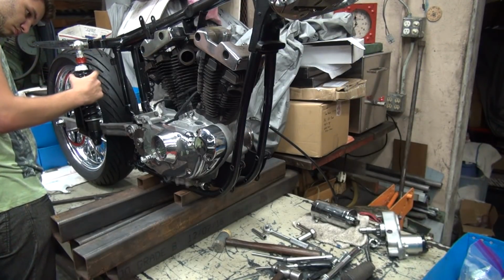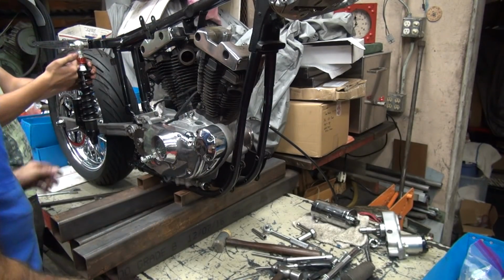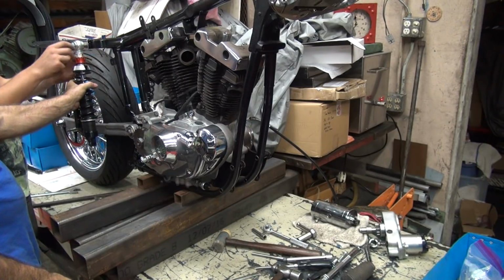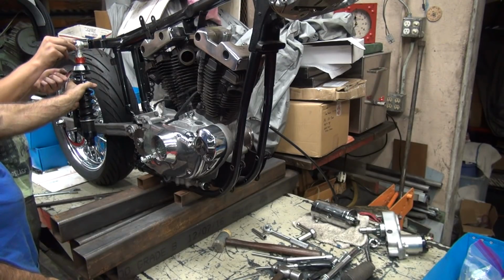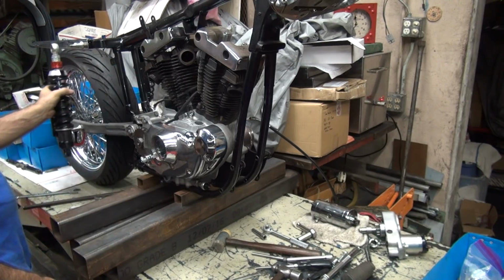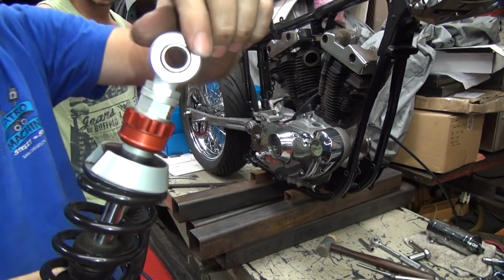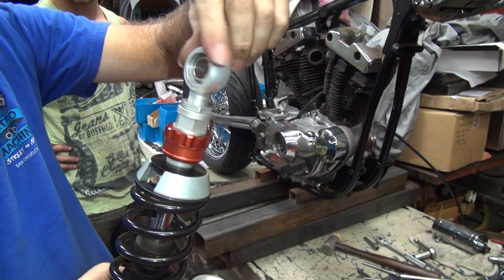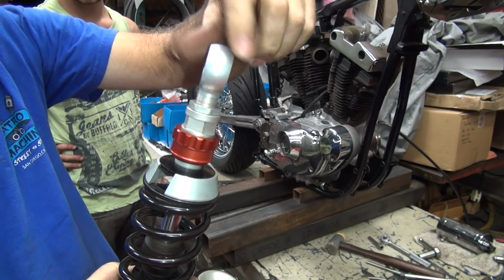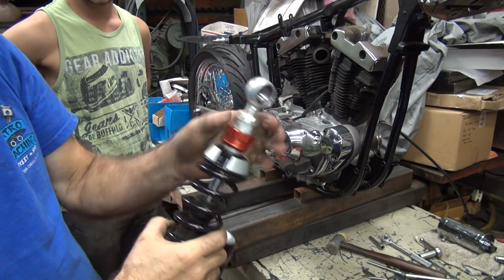Okay, what do you got going on over here? I think I got it. What's it look like? I think that this part is like a lock nut. Yes, it's a Heim joint, yes. Did you put it all the way down? Don't drop that, you might need it. Okay, here's our Heim joint. So this here unscrews. This adjusts our length. We need about 3/8 of an inch more height. So is that about 3/8 inch of thread hanging out? Sure. Yeah, that's close.